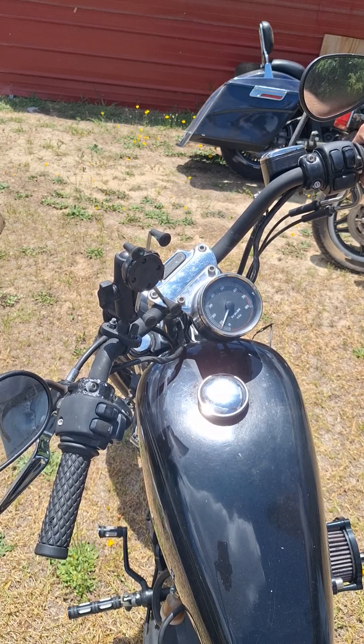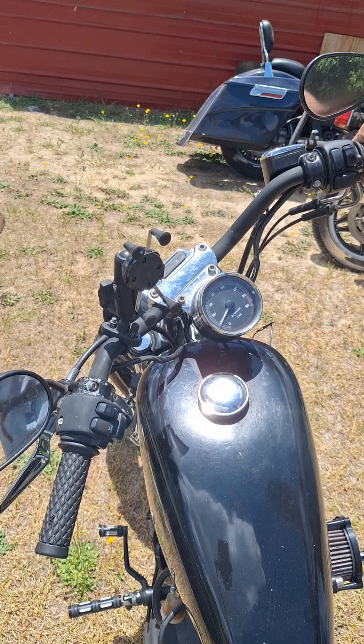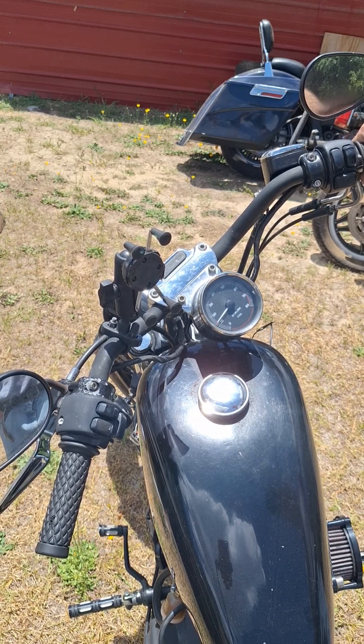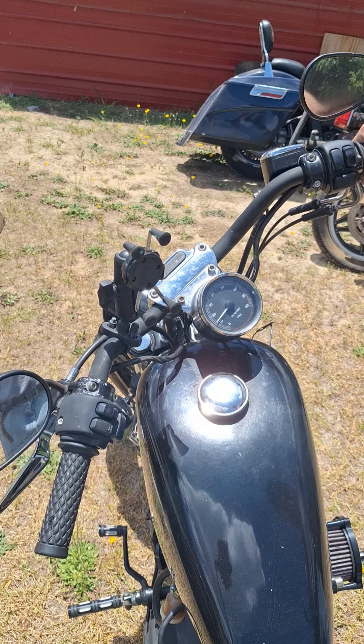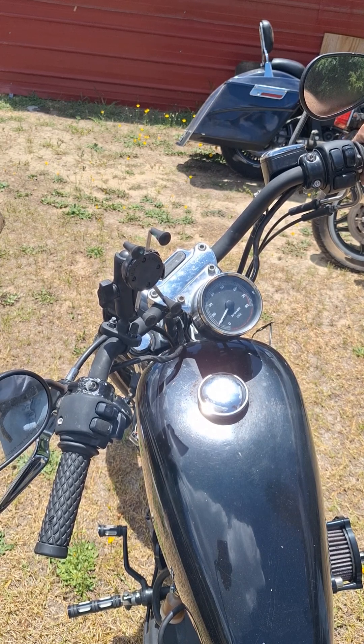Power wire, trigger wire, and a ground. It needs some work on the carburetor here. It's taking a really long time to warm up, so I'll have to do an idle drop on this thing and reset the air fuel screw.